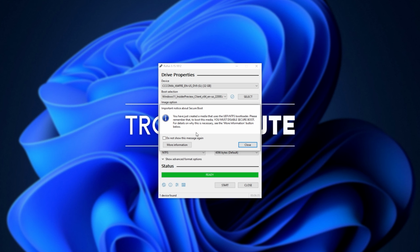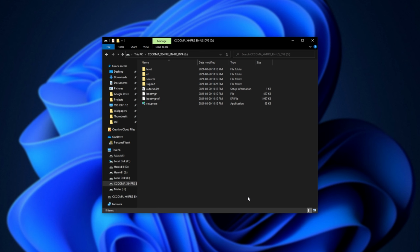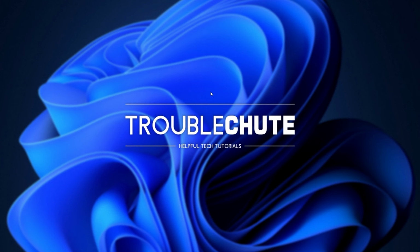And there we go. You can see important notice about Secure Boot. You'll need to disable Secure Boot in your BIOS in order to boot from this device when it's plugged into another computer, laptop, etc. From here you can click close, exit, and go ahead and insert the USB into another computer. From there you can open up the USB on another computer either while it's running and run setup.exe to upgrade to it, or you can reboot the PC with Secure Boot off, boot into the USB.